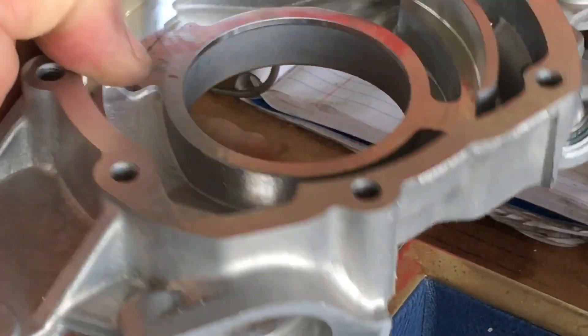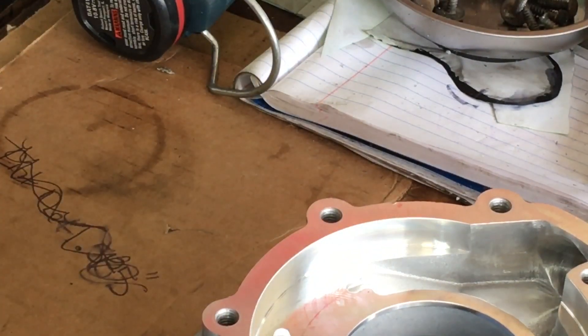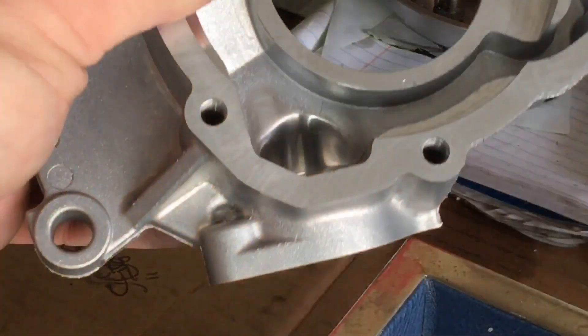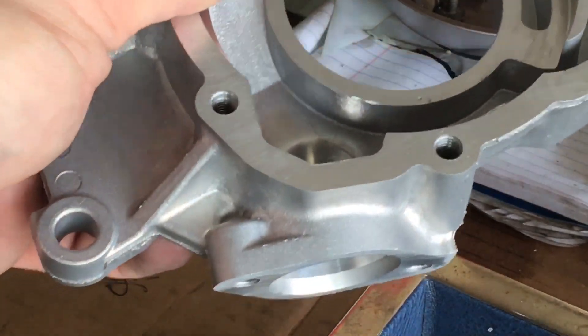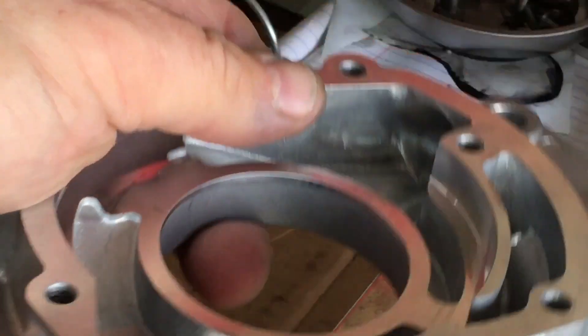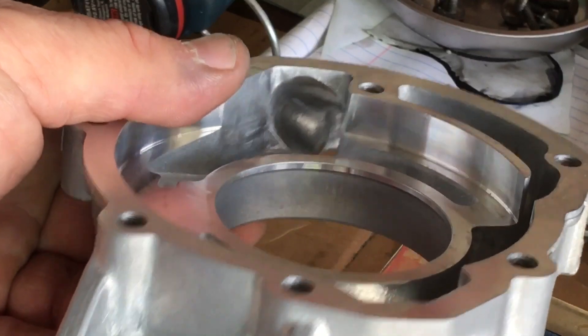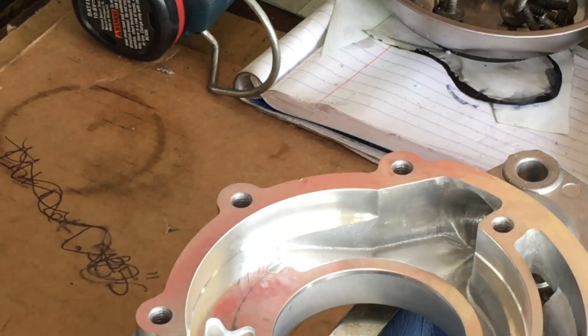Blueprint or port an LS oil pump to smooth out the oil flow and gain 10 to 15 more pounds of oil pressure at idle and at RPM by shimming at 100 thousandths. Just let your finger do the talking — whenever you start trying to smooth this out, rub it with your finger, find the sharp edges, find the casting flash, smooth it out. You're not trying to engineer a brand new oil pump, you're just cleaning up the crap they sent out. Appreciate you guys watching — please like, subscribe, and share. Keep your eyes open because I'm going to post the finishing work on those twin turbo 243 heads. Keep watching, guys. Thanks again, I'll see you next time.